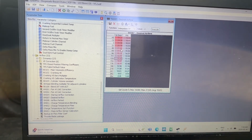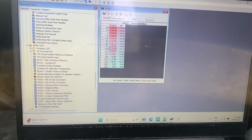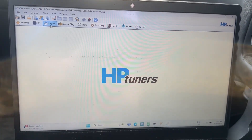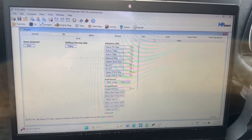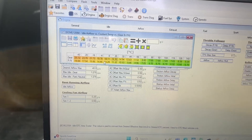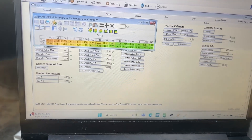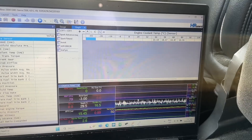Just going to save that. Now this is exactly the same in HP Tuners, just in a different location. If you want to know where it is in HP Tuners, you come over to Engine, Idle, over to Airflow — and your base running airflow is right here. That's going to open up your in gear and your park neutral tables. And you can see that's why I have that Celsius scale; I just don't have it changed over yet, and I'll be doing that shortly. And that's it — that's base running airflow.